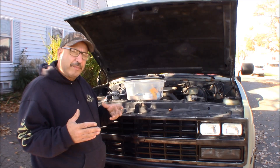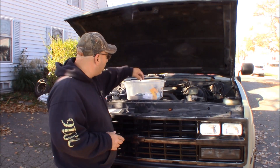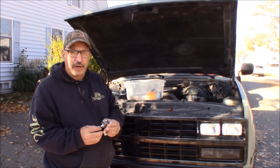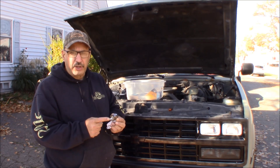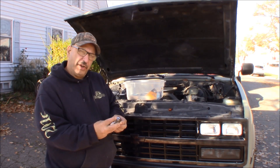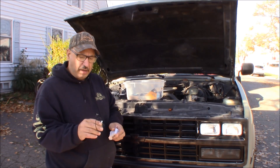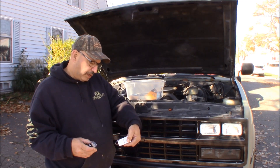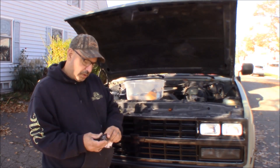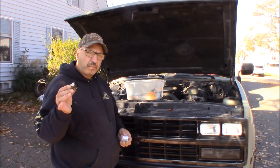So we thought we'd try a different LED bulb. We ordered another set of LED bulbs for a different project and decided to test them here. We also ordered a different flasher after doing some research. A lot of flashers are polarity-specific, meaning the line-in and load have to go a certain way — that's why some come with a base that switches the polarity. The new one is the CEC EF32RL-NP, and I think NP stands for non-polarity, meaning it's polarity neutral and can go in any configuration.